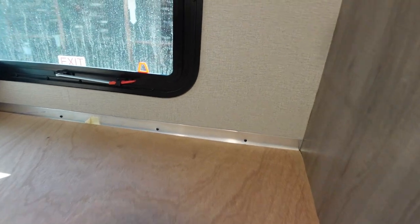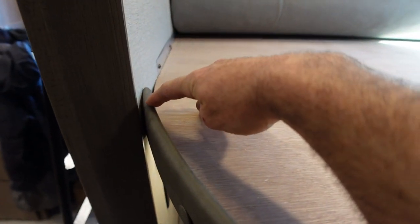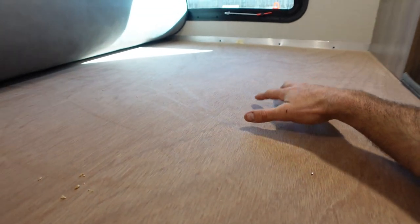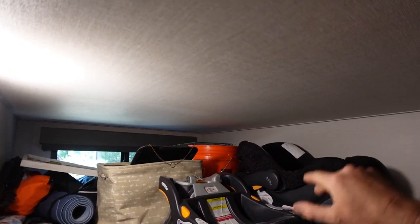This is what it looks like in the top bunk. Obviously they have this aluminum angle iron as support over here. This portion is actually screwed into this side, so that's a nice strong attachment point. I'm hoping I can leave this guy on because it looks nice. I might have to just trim it a little bit over here so it slides past this other bracket, because I really want to keep the factory brackets because they're strong. My goal — I think where I'm going to start — is there's a seam right here in this balsa wood. I think what I have to do first is pull this balsa wood up and then kind of go from there. I'm trying to make it as nice as possible and keep it as factory as possible.